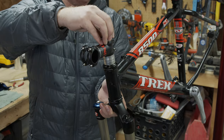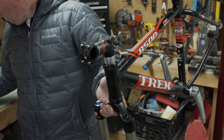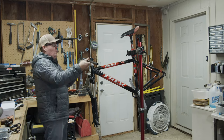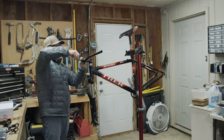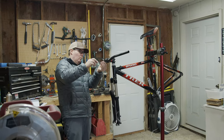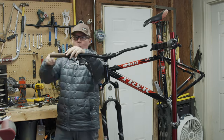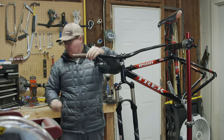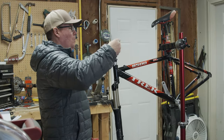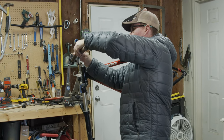As far as the rest of the bike, modern geometry has a shorter stem, wider bars, and a simplified one-by drivetrain that makes shifting and operating the bike that much quicker and easier. While this bike did need a lot of modifications, just shortening up the stem 2 centimeters, raising up the fork, makes this into a much more comfortable ride. For the front end, I'll be running Hayes V-brake levers with a mechanical disc brake and an Avid rear V-brake. It won't have nearly the stopping power of hydraulic disc brakes, but still pretty good for what it is.